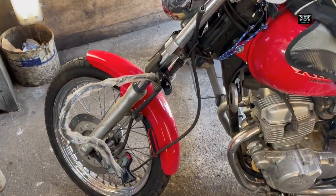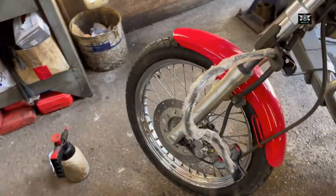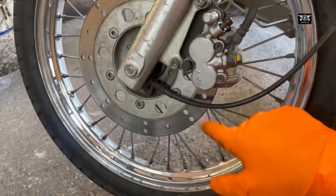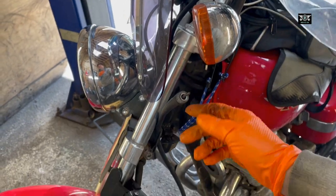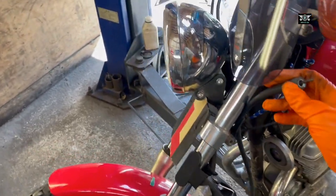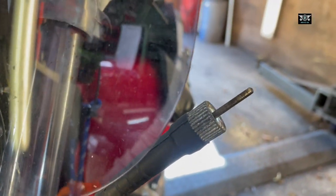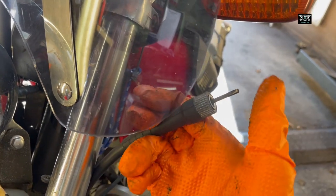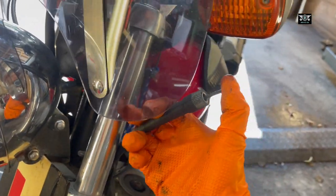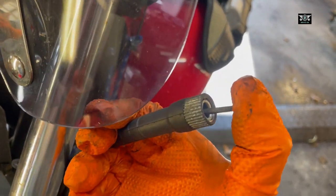So far I've discovered that with the drill everything is working at the speedo end. As I turned the wheel I can see the mechanism inside is actually turning. I just reconnected the cable here and disconnected it up top again, and what's happening is when I turn the wheel that doesn't turn — however if I press this cable, when I turn the wheel it actually starts turning.